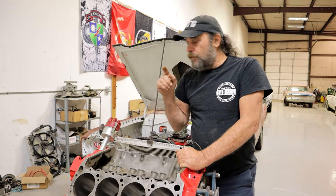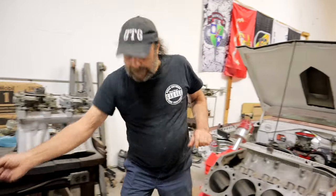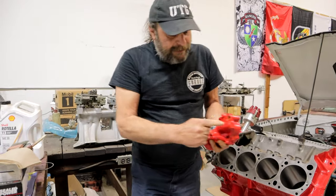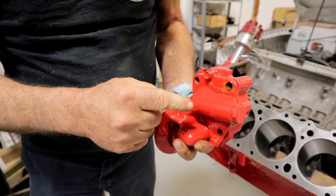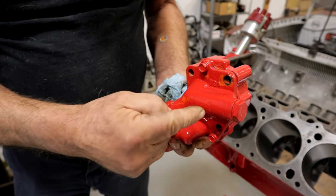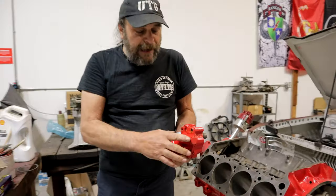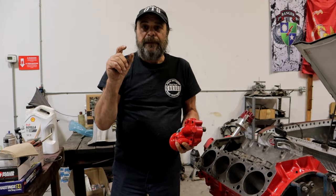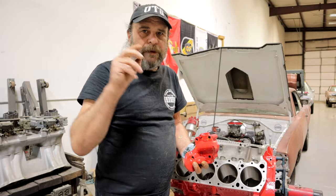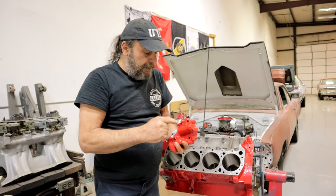Now go one step further — talk about real damage. That hurt your top end, but that metal would eventually find its way. This is the oil pump bypass — this is what regulates the oil pressure. This is really the only mechanical part of the engine that gets unfiltered oil, aside from the oil pump gear and rotor itself. Any of that metal that got in here would bind up the bypass and create a zero oil pressure situation. If the bypass doesn't seat completely — just a tiny bit of movement regulates the oil — any of that metal in this section, which is before the filter, all unfiltered oil, this would kill the motor.